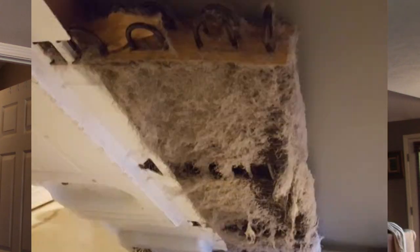I'm not talking about that coil pack on the back of an old refrigerator. Most refrigerators have the coils up underneath, and it looks very bad — something like this. Not only does it look disgusting, but it's actually preventing the refrigerator from working at its optimal level. It can't cool those coils properly when they're coated with dust. Air is not traveling past them anymore, so you make your refrigerator work harder, which is going to make it wear out faster and use more electricity. So we're going to clean it out.